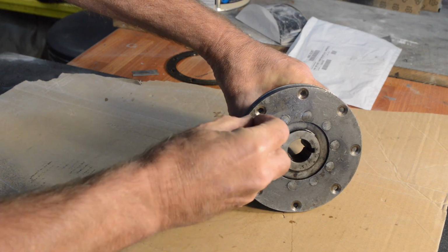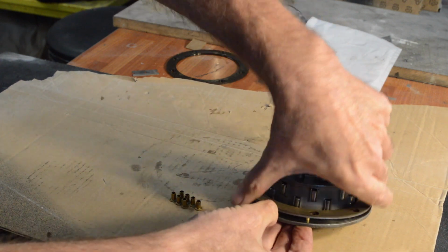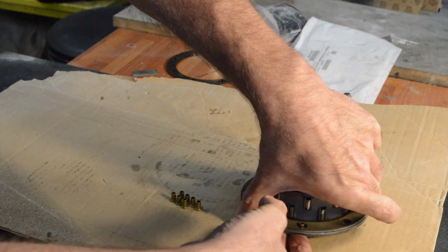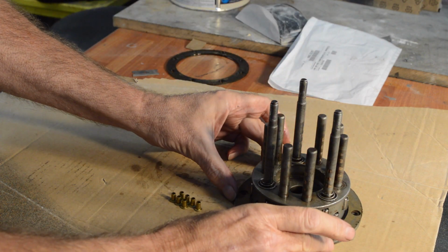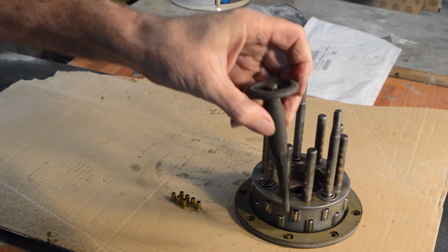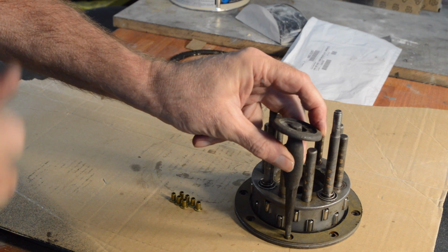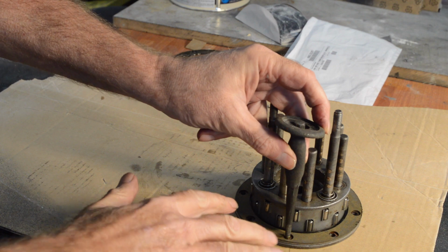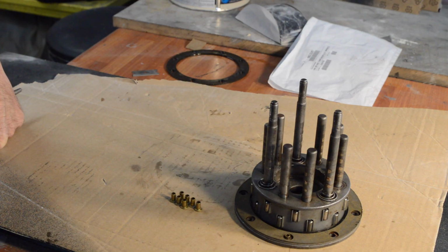So on the back it's recessed, so the rivet head will sit like that. Yes. And then that'll go down there like that. And then I've got to squash it, of course. But it's how to do that. And the only thing I can think of is to use a rounded edge punch, which will just fit in there. Hit it to try and roll it, and then use a flatter, wider punch to compress the whole thing.